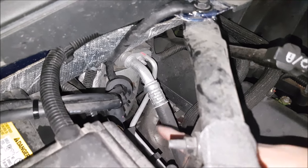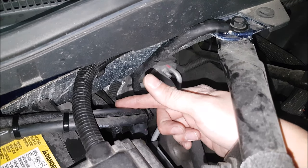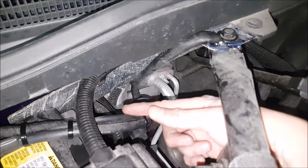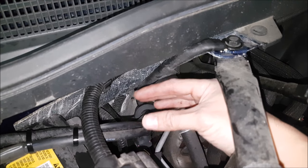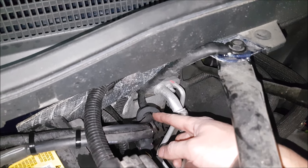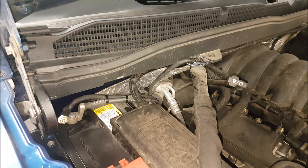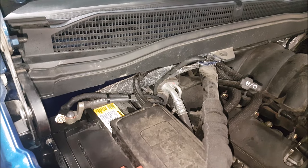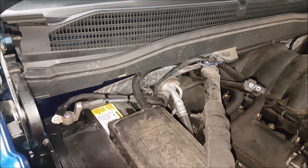Hopefully that helps you out guys. For those of you in newer trucks, you understand what this is for and how important it is — if you're running any new wire, pass it through that sensor so the charging system knows what's going on. Because if we were to bypass this, since the wire is newer and thicker, electricity takes the path of least resistance and starts to bypass that clamp meter, so the charging system might not apply the right amount of voltage and do its job properly. Comment below — do you do stuff like this? Do you do preventative maintenance or foundation work when adding onto your vehicle, or do you just hook up auxiliary devices and leave the grounds alone?